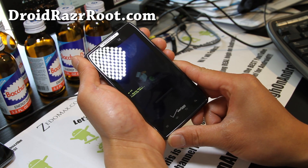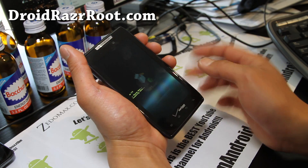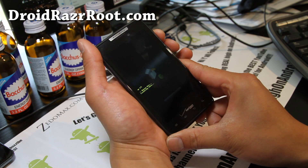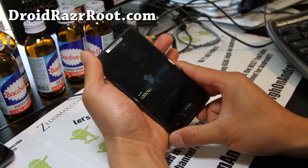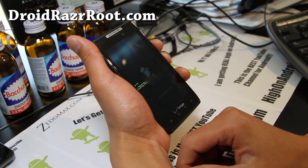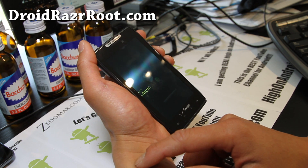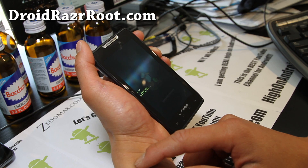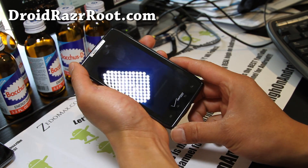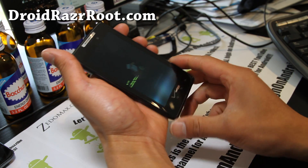That's pretty much it — you reboot and you won't get rid of SafeStrap. You'll have to run SafeStrap again and uninstall it using that app. Also, this video can be helpful if you don't know how to get into fastboot. And if you get stuck in flash failure mode, turn off your phone, hold down volume up and volume down, then plug in the USB when you're out of power, and you'll get the normal recovery. You don't actually need a factory flash cable — you can do it with the buttons.